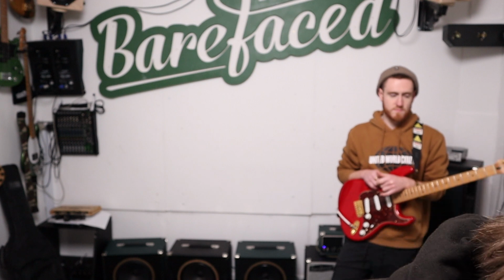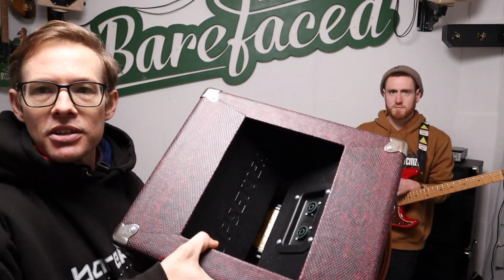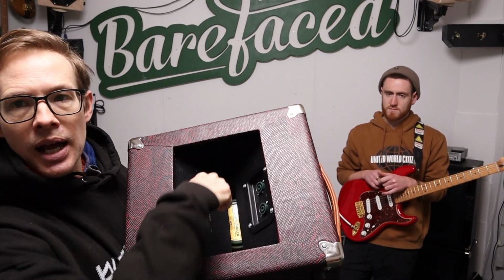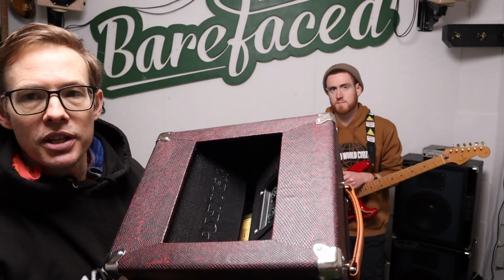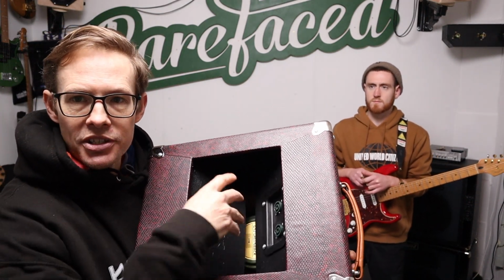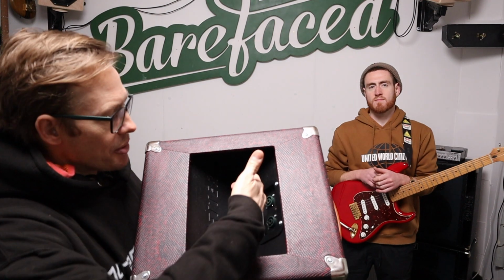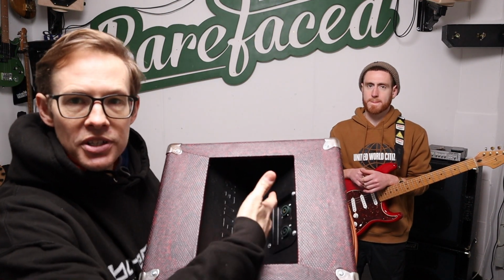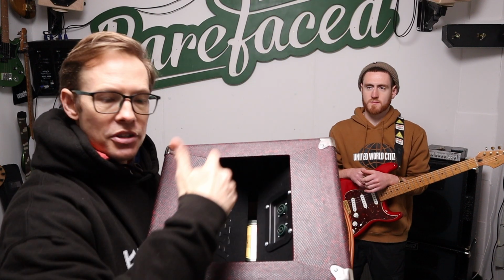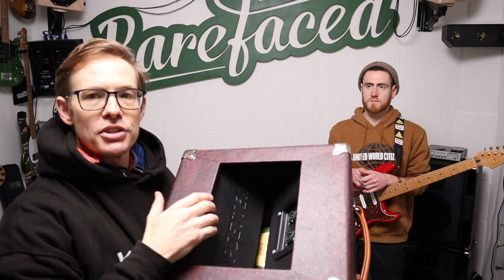So, if you're new here, this is the AVD. You can see the back of the speaker, the magnet in there, and if you look hard enough, you'll see the cone. We've got these panels here, and a slot of very specific width. It varies in width, actually, to do what we want it to do. That lets the low frequencies out, it acts like a port, so you've got a Helmholtz resonance, and at mid and high frequencies it lets the sound through this. The narrow slot diffracts it sideways, and then this waveguide couples it to the room, so you're basically transforming the acoustic impedance. So you get efficient coupling of these vibrations out to the room, and because it's a narrow slot that way, it spreads the sound predominantly out sideways before it then bounces round.